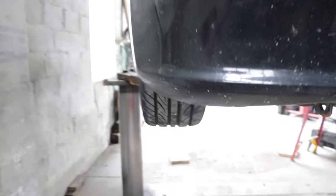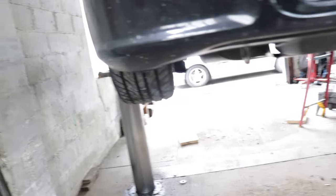This is just us slapping it together. The way that you do this: you measure the center of the tire tread in the front and then in the back, and you want to have it about an eighth of an inch closer in the front than in the back — gives a little bit of toe in. So at least you can get to the alignment rack. It's going to feel okay on the road but it won't be right, but at least it won't feel crazy and you won't be hurting anything.